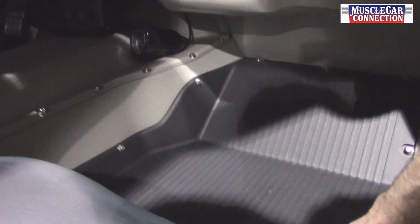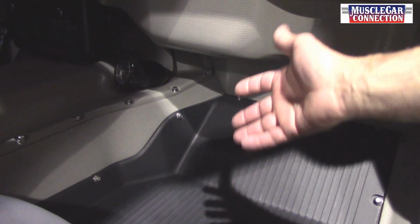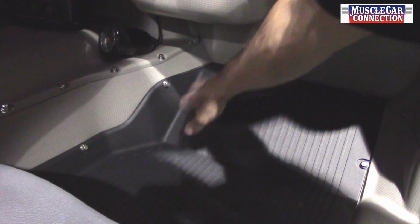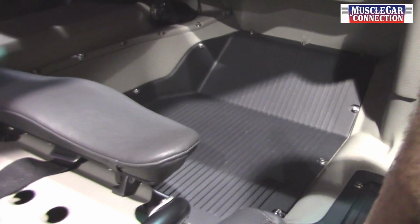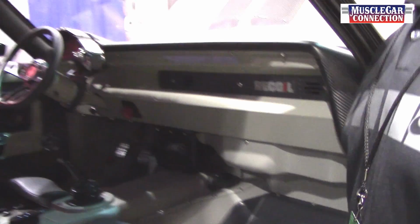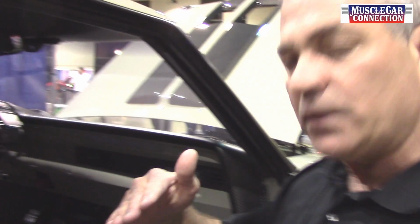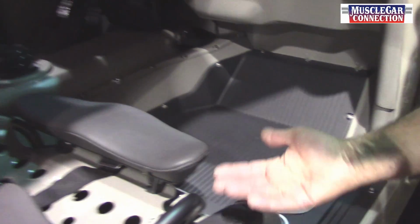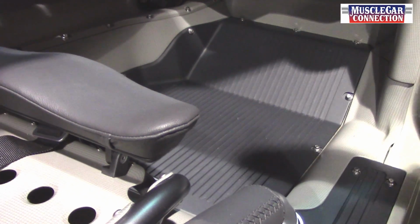These were just milled aluminum pieces. Once we milled them, Sean then bent them and then added TIG down the side pieces. So if you didn't know better, it looks like a rubber mat. Right, that's the intention, rubber mat. Or somebody else looks at it and says, man, they had a chunk of aluminum that thick and they milled it? No, that wasn't what we did. We actually took flat, milled it, then bent it, then added the sides.